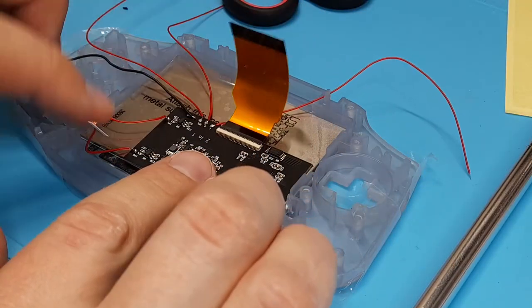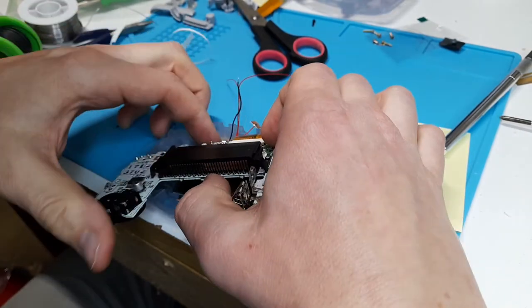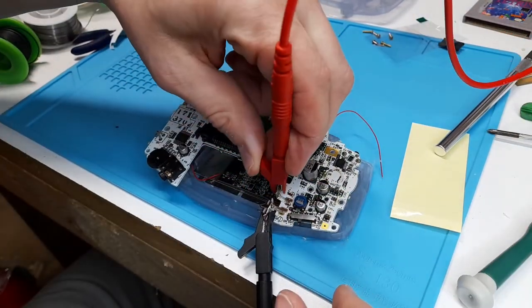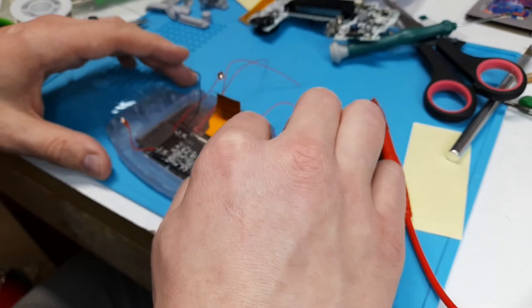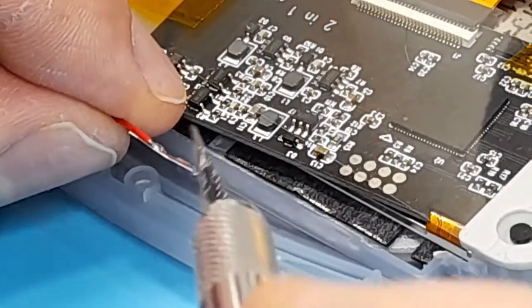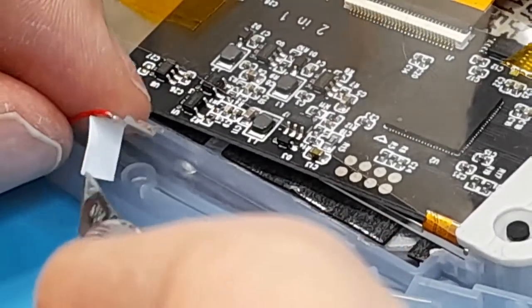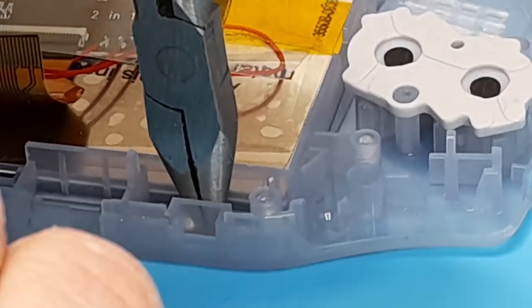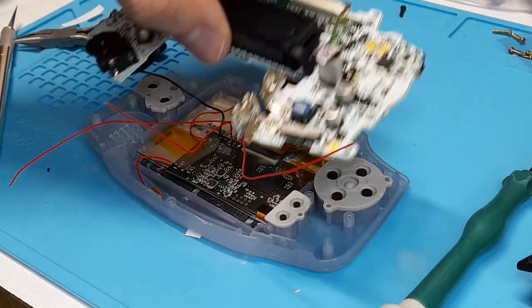With the version 3, we have another piece of insulating film that's just going to protect the PCB from shorting out on the main board. I should have done this earlier, but I'm going to test out the screen to ensure it works — I threw it on my desktop power supply and flicked it on. At this point, I put the buttons and the conductive silicone back in because I didn't want to forget them when I put the motherboard back on. For the version 3, we have these touch pads and they're super finicky. If you touch them with your bare hand, you can easily destroy the adhesive or they fold over on each other and are basically useless after that. So I took the backing off with a small knife and pressed it down using a small tool. If you do accidentally destroy the adhesive, you can use tape to secure them to the shell. The color change pad goes on top and brightness control on the bottom. When putting the motherboard back on, separate or mark these wires so you know which is which.